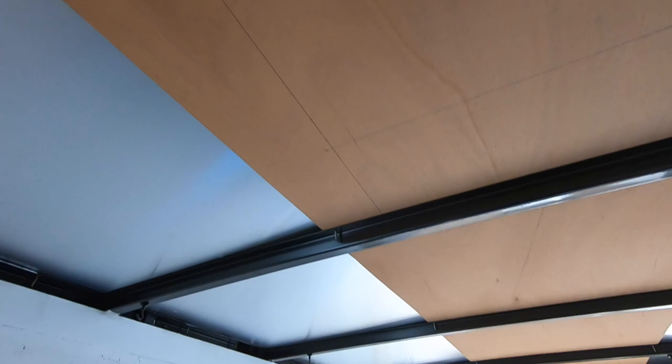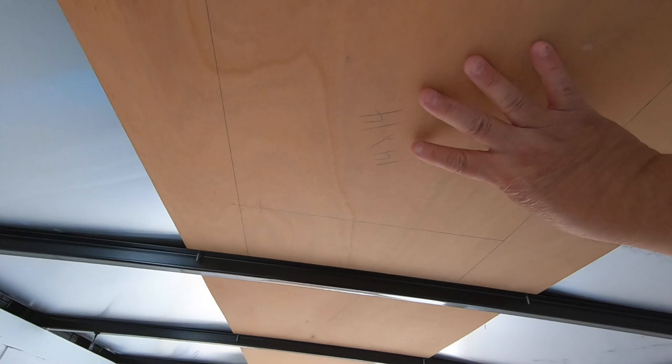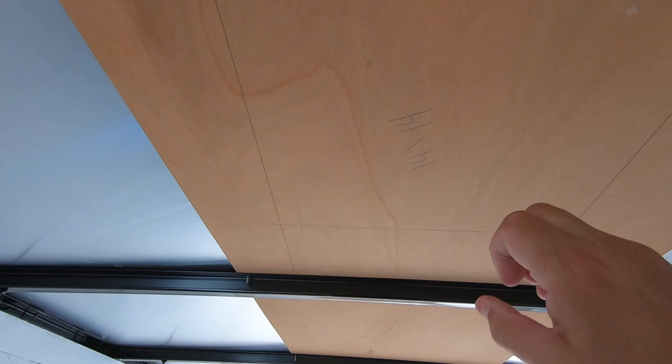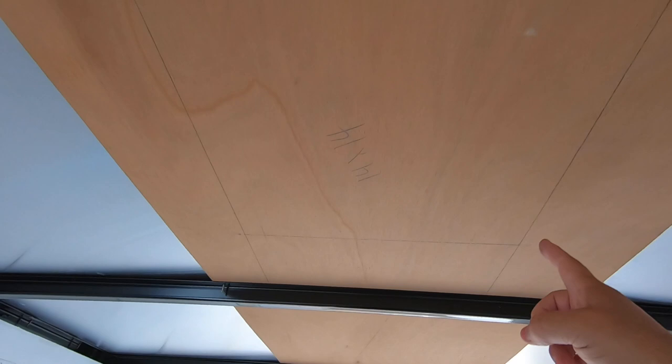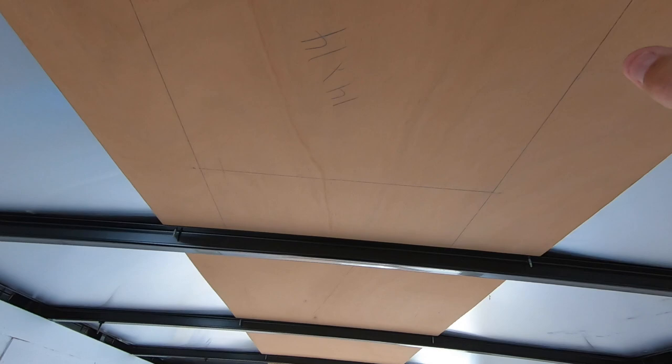This is kind of a U-shaped beam — a channel — this aluminum bar across the beam. So this took a little doing. I've got my 14 by 14 hole. One thing at a time — just want to do your due diligence on where you want to put your hole. I kind of eyeballed the center. I'm going to have to cut through here with some drill holes — four drill holes — and then I've got my jigsaw. I'm going to do it from the top coming down, but I'll put drill holes through first to guide me with the jigsaw.